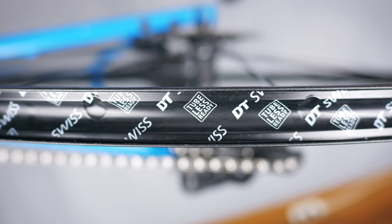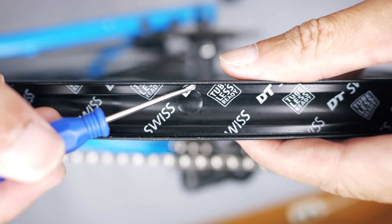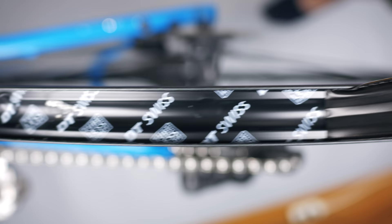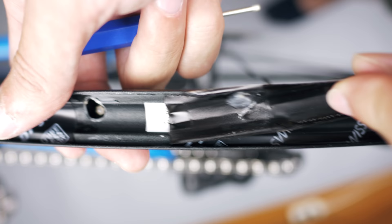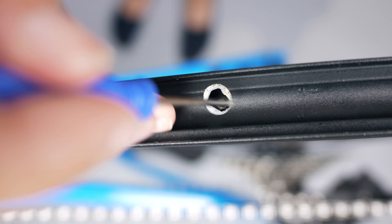That's the point I gave up for the night. When I finally went back and really checked the tape, I realized that the offset spoke holes on these rims had caused the old tape to become indented into the spoke holes. That meant if the tire wasn't 100% seated, air would definitely leak out around the spoke holes. As I removed the tape I also realized it was probably damaged around the spoke holes, as I could see a lot of leftover sealant at a few places.